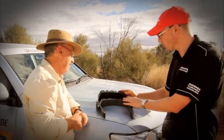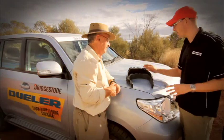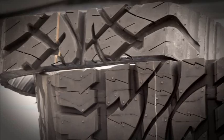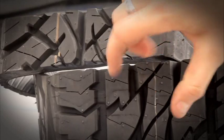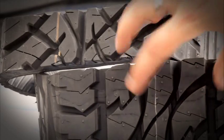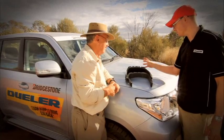The blocks squirm, and as they're loaded from heavy side loads or front and rearwards, they actually contort. That means that at the steering wheel you feel quite a sloppy or unstable handling feel. So that's one important reason why you can't have too great a tread depth.